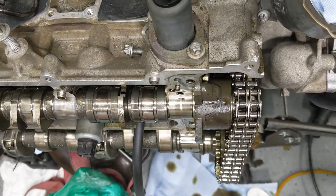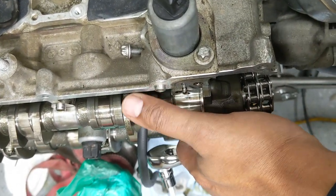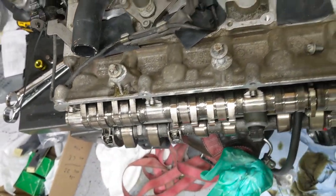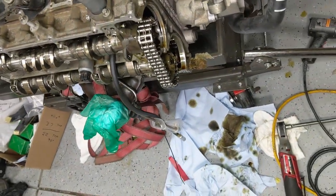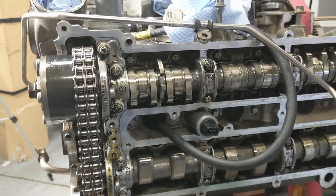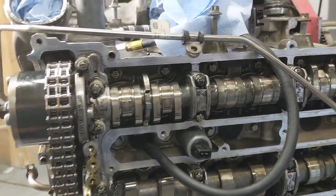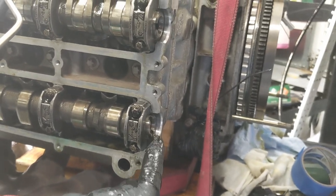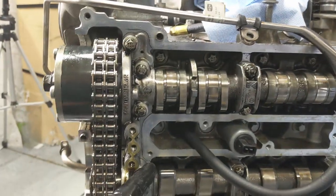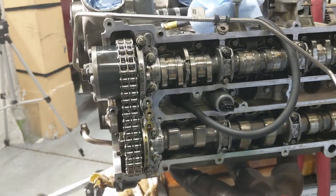Just notating the position of the cam before I remove it - the part number is stamped here. I've put a Sharpie mark there to line up at the top, but I've also got the horizontal slot on this end to line me back up. About to pull the cam out. Going to pull out the bank two camshafts - the left side is bank one. The camshaft was spun, so the timing marks are here horizontal and 11 o'clock, this one's pointing out, this one's pointing out. Hopefully pull this apart and take a look at it.